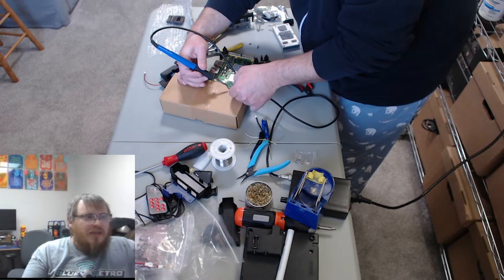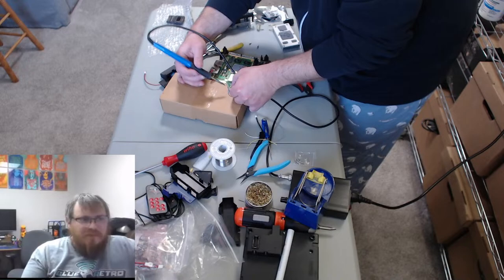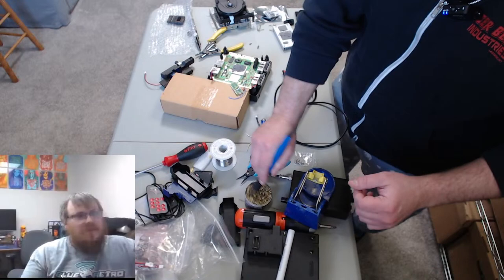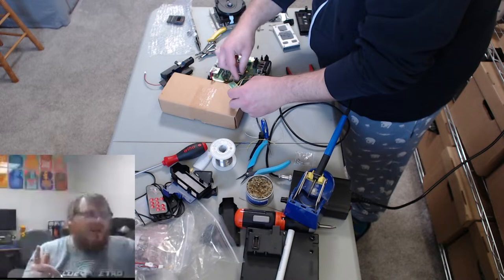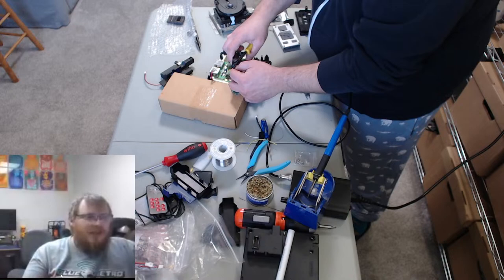There is a mode for that, DCPI. When you go into the config menu on blueretro.io, if you select the preset options, there's a preset for doing the 95% pull, and then the last 5% pull will do the click at the end of the GameCube analog triggers.